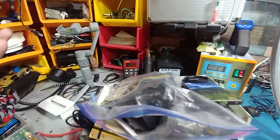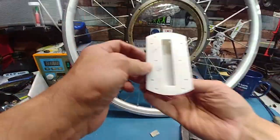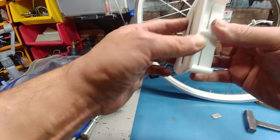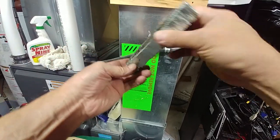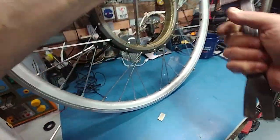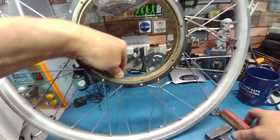These are worth saving. For instance, I made a ribbon tweeter — I 3D printed a ribbon tweeter for audio and used magnets recycled from a hub motor, which works pretty good. These old hub motors from years gone by that have died are great for projects or fixing another hub motor. Once you get the first magnet out the rest come out pretty easily — it's just time consuming to sit there and tap them, lift them up, and stick them together.